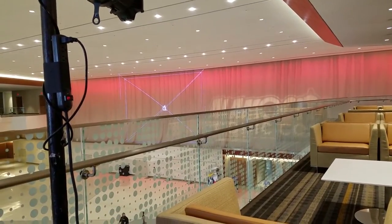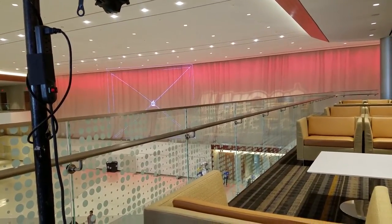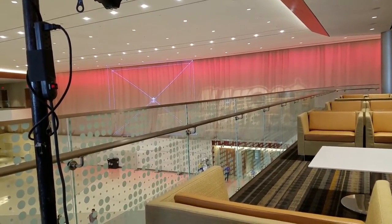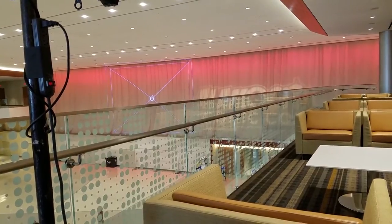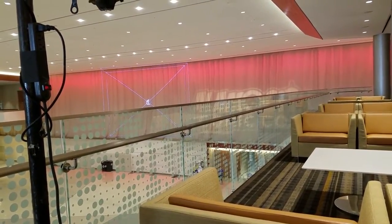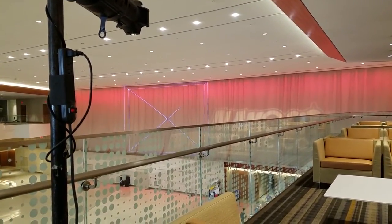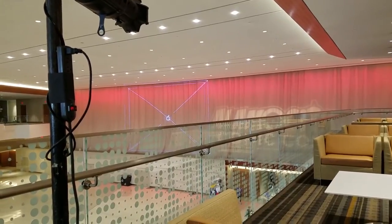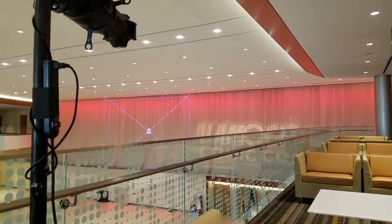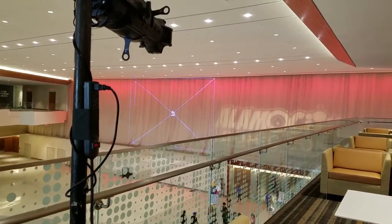I now have my one center line. Now I'm going to adjust the left and right. This isn't going to be perfect — I'm going to adjust this when I get to fine-tuning geometric correction with the crosshatch pattern. But the center X and the numbers are now roughly centered. You can see that scan zone 6, which is scanner number 2, is slightly larger than scan zone 1, which is exactly what we want.